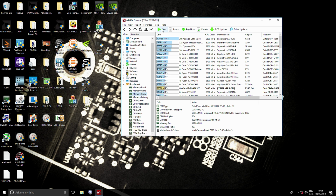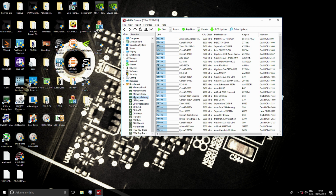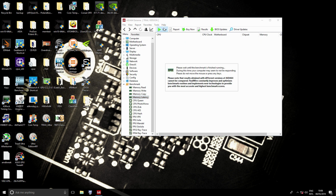I think G-Skill already demonstrated some 32 gigabyte DIMMs at Computex doing, what was it, 4,000 megahertz? But the timings were absolutely atrocious. That's what I'm going to be basing all of my timing information on. For the primaries, we're probably going to go to 19-30-30 or 21-30-30, just to make sure I don't get limited by memory frequency. I want to see how far we can ramp up the memory frequency and then see what the timings will do after that.